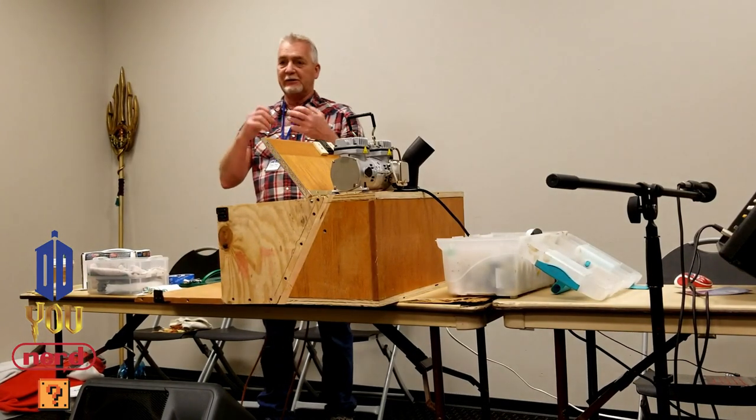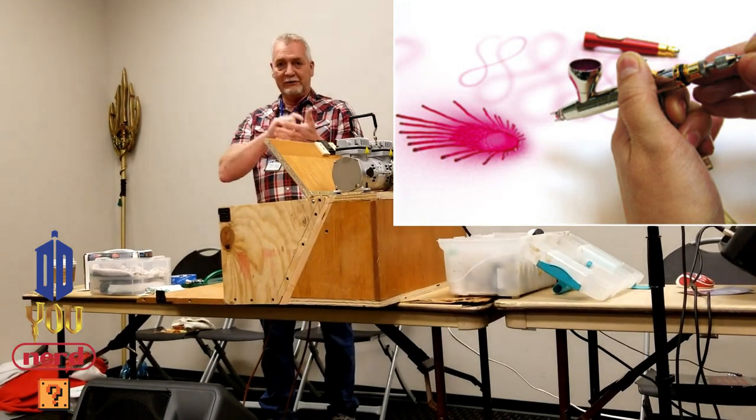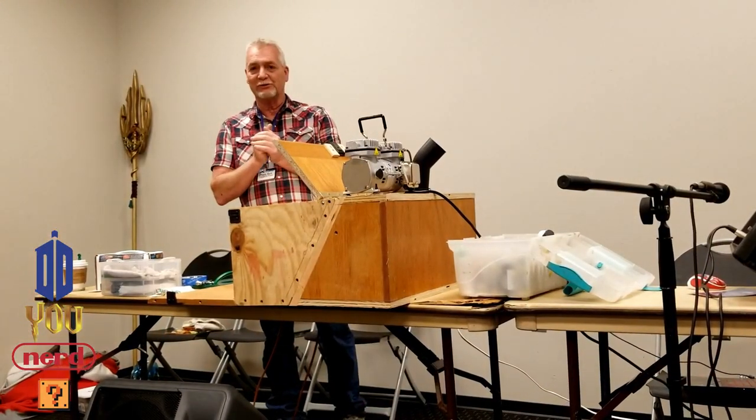So if you get too much, yeah, you're going to get what's called spidery. And that's when you start and you just get all these legs that come up. You're probably too thin, basically it's just because you've got too much reducer.